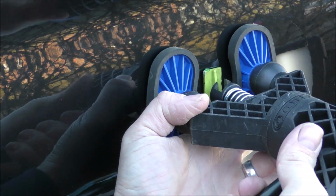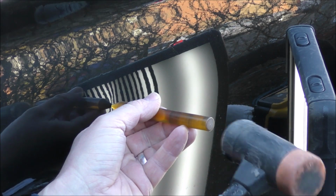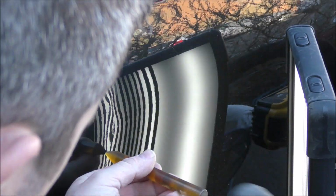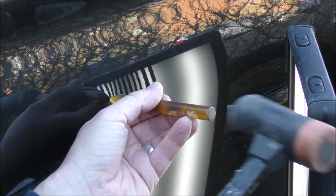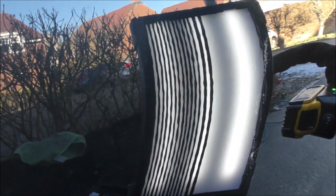So my first two pulls pulled out quite a lot of that dent. You can really see those lines pinched together. But this third pull, I pulled it just a little bit too far. Now thankfully not too far that I couldn't save it, but I just have to spend a little bit more time on the tap down process than I originally planned. So it really goes to show the power you can create with that combination between those tabs and that lifter.